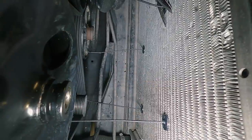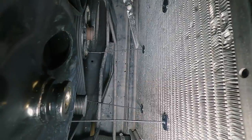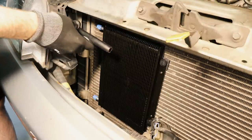Now this radiator is looking a little bit worse for wear, but I think it's going to do the job for a few years longer. So attach all four clips, make sure they're nice and tight. And then once you're happy, just use a pair of scissors to cut off the excess length of the pins.